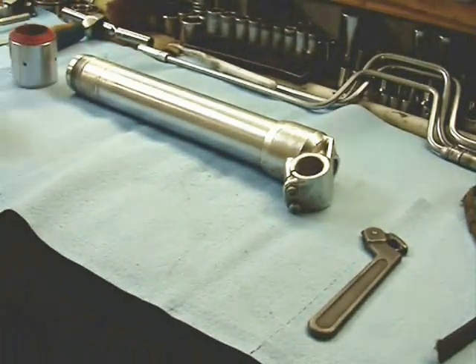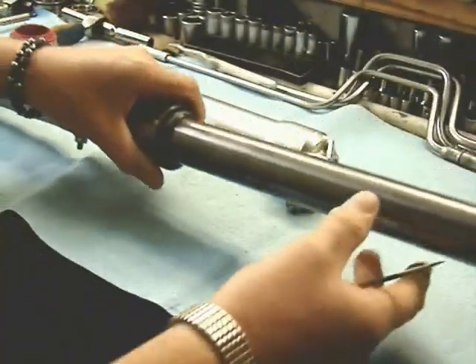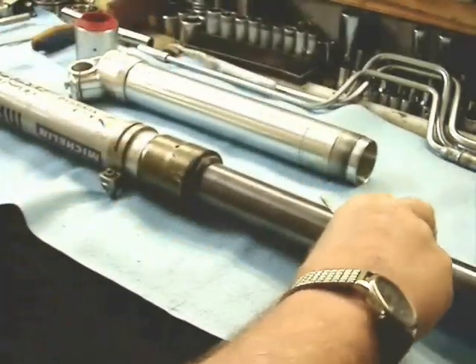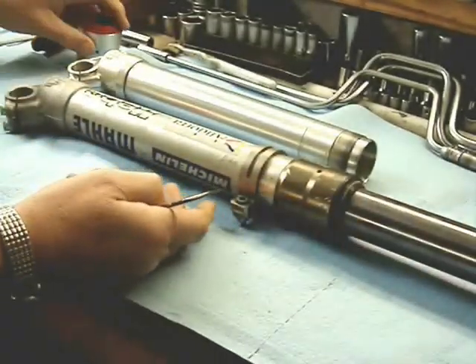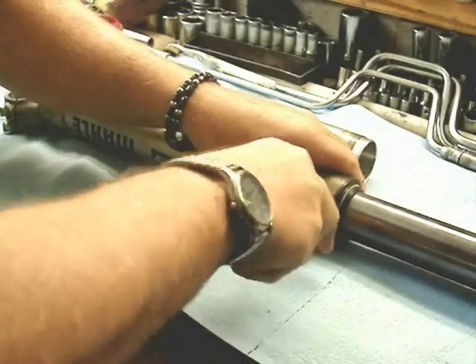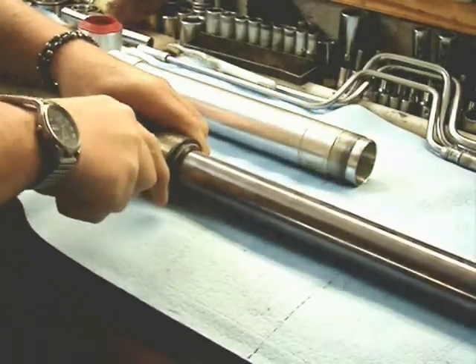There are different colors of the chromium plating — in '97 they were gold, then there were black, then gray, and then just silver chrome. The different titanium nitride coatings. But the legs themselves interchange up through model year 2001. The 2002 Pro fork is basically the same, but it's shorter — the upper stanchions are shorter as well as the internal dampening.